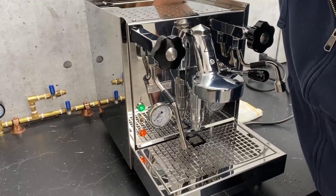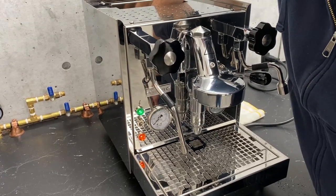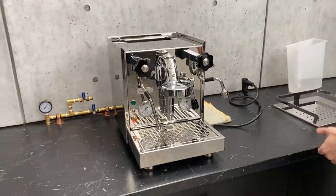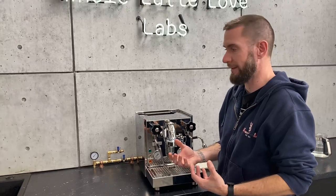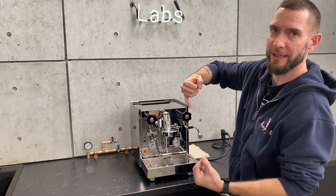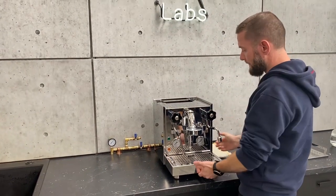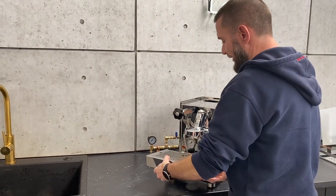Then just lift the lever and let it run. I'm going to get some of it out of there — it's not going to get a whole lot out, but I usually let it run for maybe 20 seconds. You can gauge just by looking at it how much is going to come out. You're never going to be able to get all the water out of the heat exchanger because of the way it's designed — it's got two tubes that go into the main cylinder. But you can get enough out to protect it from any freeze damage. It's got a lot of expansion room inside there, so it's one of the areas you have the least concern about.